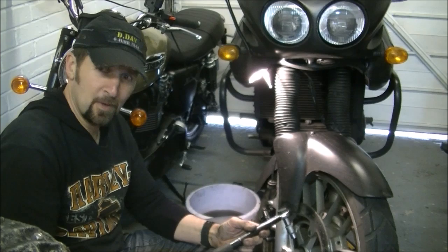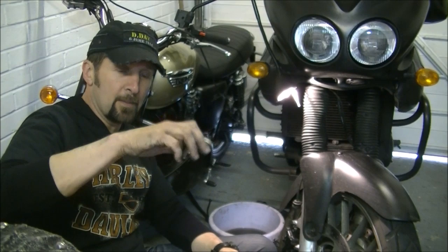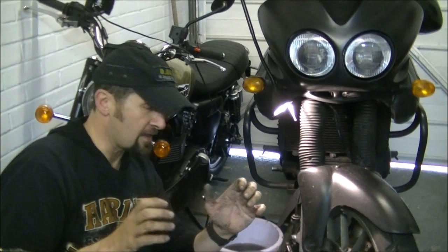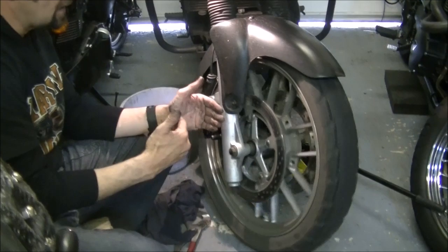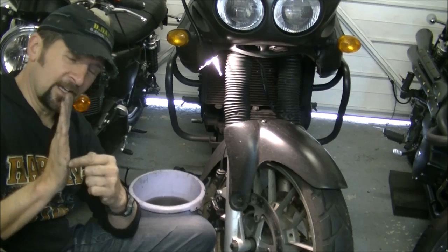Really important at this point to pump the brakes out. Make sure that when you reach up to the lever before you go for a test ride, you pump the brakes so those pads come back out to the correct operating distance - you've pushed them back out of the way with a good three or four millimetre gap. Just pump them out until they lock, then take it for a test ride. After a couple of actuations in anger that copper slip will settle in, so come back and check it. You want that free running minimum.